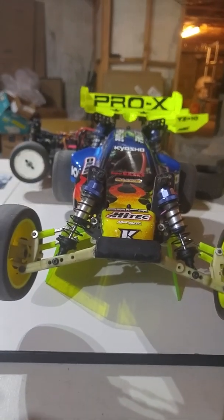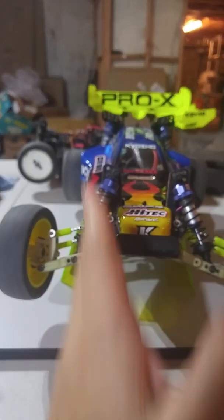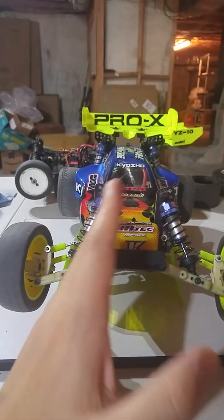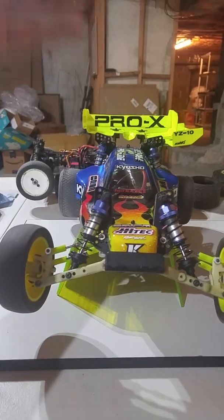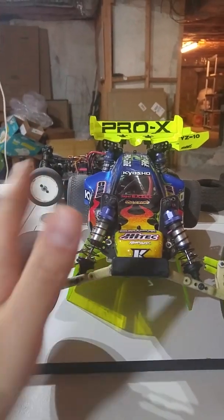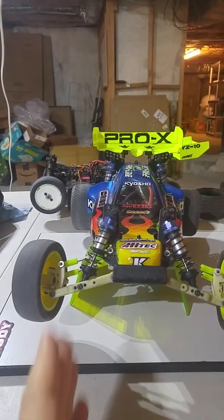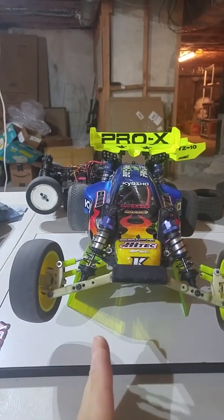So that's why if you have what is otherwise the same exact average mounting location for a vertical shock and an angled shock, that angled shock will give you better landing performance on your jump, because as the suspension compresses, it gets a little stiffer. With a perfectly vertical shock, that suspension rate, that effective rate, is constant throughout the entire movement of the arm.